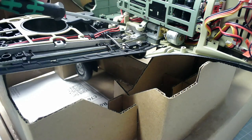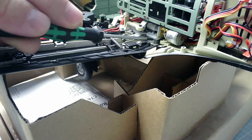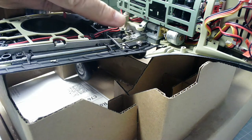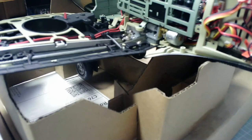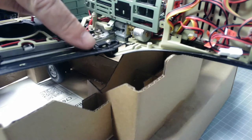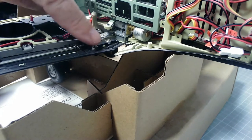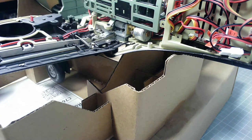Here's the motor — you can actually see where the tab is, right in the middle. So you have to take the motor off. Just unscrew this housing — there are two screws here and two screws on the other side. It probably takes about 10 minutes to be honest, but just take your time taking these screws out; you don't want to over-thread it or damage the plastic. It didn't take that long really. Just remember to put these flaps back in correctly, because this flap has a tab that sits and inserts into there, so you must make sure that is correct. But it's working fine now, which is brilliant.